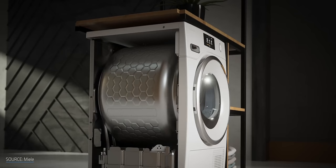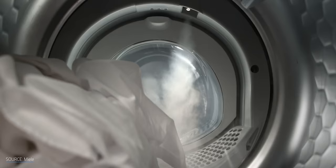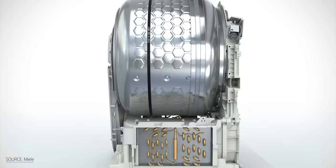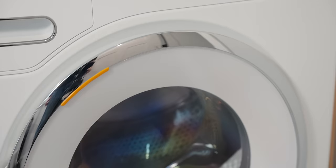What about putting a heat pump in your dryer? There's some insanely cool — or should I say hot — engineering inside this dryer that doesn't require a vent to the outside or a high voltage outlet. This thing runs off of a standard 15 amp household outlet and will use 4 to 5 times less electricity than a typical electric dryer. So if they're that good, why aren't they used everywhere?